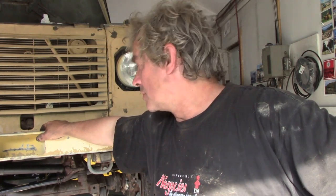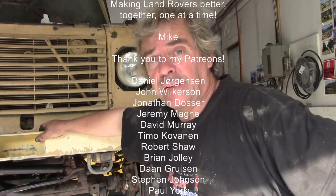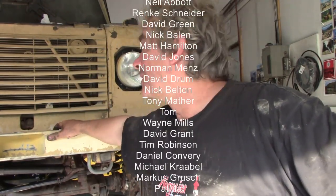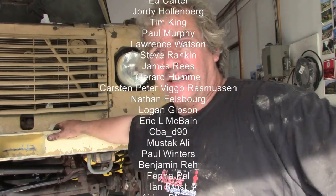Well there you go - a day in the life. I've got all the back brakes done. The other side didn't need welding but it was all stiff and seized up, so we've bled all the back brakes through - shoes working fine, pistons working fine. Tomorrow we'll do the front brake pistons and might just take a shim out of that top joint. But other than that, it's not too bad actually - it looks really bad with the paint and stuff but mechanically it's not too bad. Let's see what happens tomorrow.